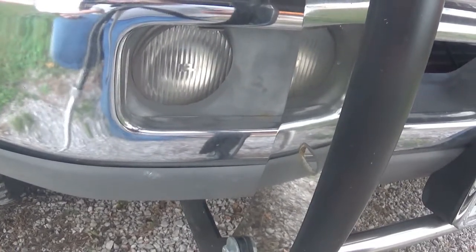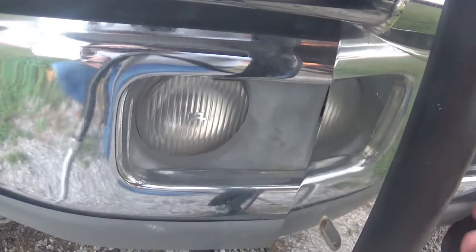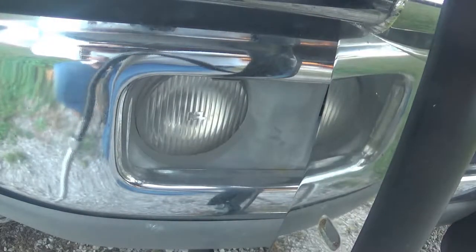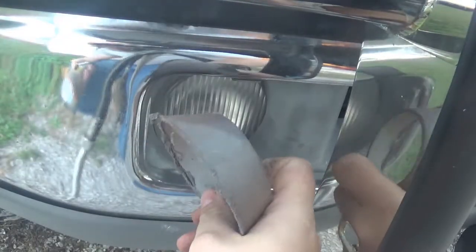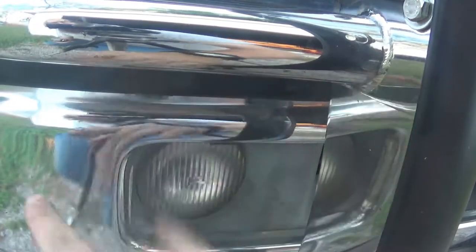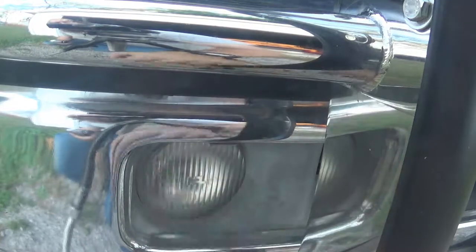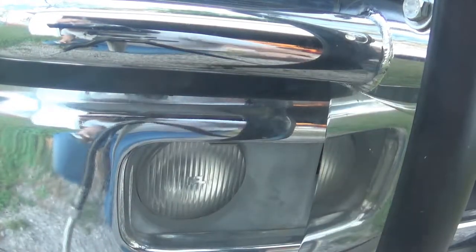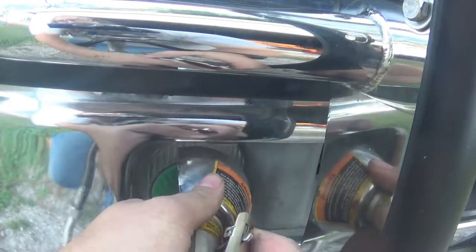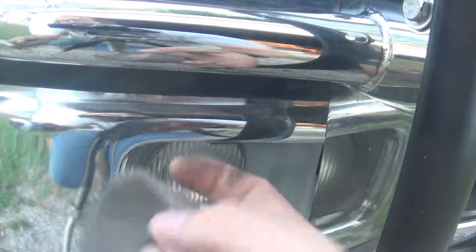Let's start with what I did on these fog lights. Originally, since this truck never had fog lights, I would have had to take this whole plastic bezel piece — the whole piece that goes all the way across — and that would have required me taking this brush guard off, the bumper off, bending it forward, undoing the clip that holds this in, and snaking it out through the back there. I didn't want to do that. So I took my little cutoff wheel, went so far in — this here is actually what was in there and the light won't fit. But the good thing about these bumpers is they already have holes up under here where these actually mount in. So I just took the bolts, stuck them through, and was able to clip this in. The trick was I had to go in and cut about an inch or two, all the way around the circle.